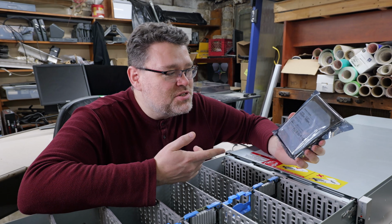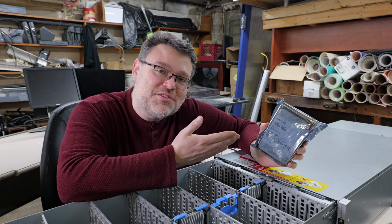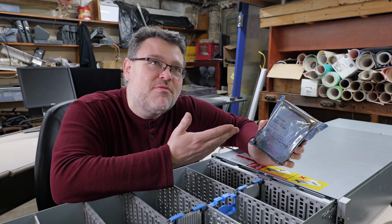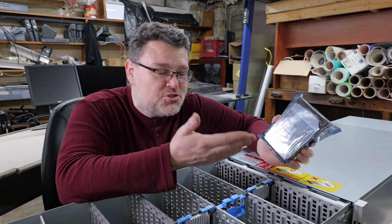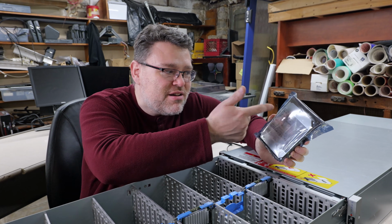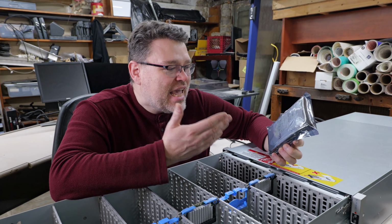Let's take a second to appreciate just how anachronistic mechanical hard drives are. This is a precision mechanical instrument. It has a motor in it. Well, two motors: a motor as you think of a motor, and a voice coil, and it can access with precision 250 trillion bits on those spinning platters. It's the Rube Goldberg machine of storage devices. I can't even believe it.